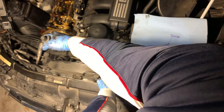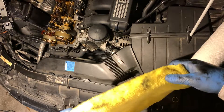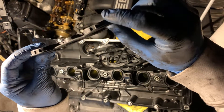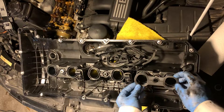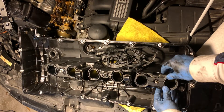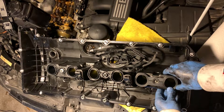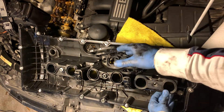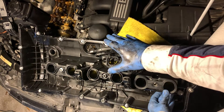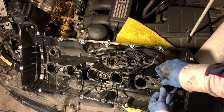Let's put the rubber back on the valve cover. This needs to go inside the raised-up part. You want to make sure you push it all the way in so when you flip it over you won't have any rubber falling. Then we tighten it — make sure the rubber isn't pinching itself because it can turn on you.